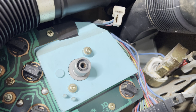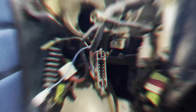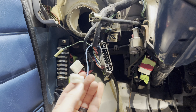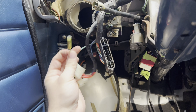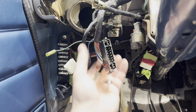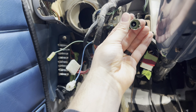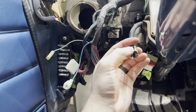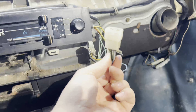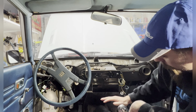It's really just three little tabs that you gotta pry back that snap in around this collar here. This connector gave me a really hard time — I don't know why but that thing was tough. This one here is easy to pull out, this one is a little tight — you just gotta pinch these guys, but overall it came loose. So four connectors there, and the one that goes to the back of the speedometer — you just have to pry these three little tabs out of that collar with a small flat head and no problem. Then you've got the fifth connector at the end, which was just a quick pull out as well.